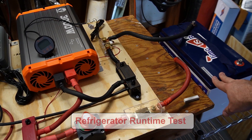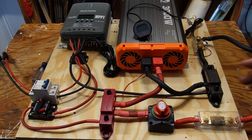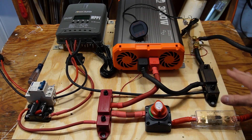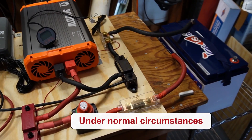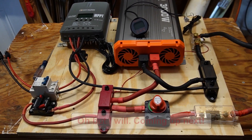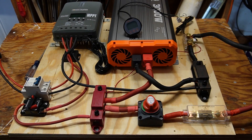The TimeUSB battery is now fully charged. I'm going to do a basic refrigerator test with my DIY solar generator I put together. I have a 3000-watt inverter — my next video will be a review on this. I want to point out that this is a 3000-watt inverter that can draw a whole lot more than this battery can handle. This is just a test and I'm not going to be drawing anywhere near 3000 watts. I think you should probably have three of these batteries wired in parallel for the full capacity of this inverter.